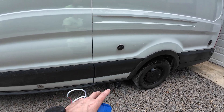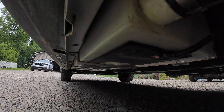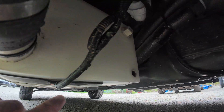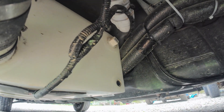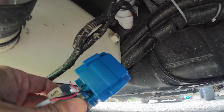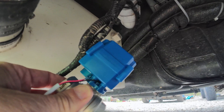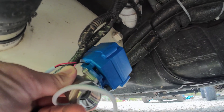We're going to keep everything in place and add this additionally. I'll bring you under the van — you can see this is the outlet for the big line. We have a spare half-inch bung, basically just a cap threaded in there, and that's going to be the basis for how we mount this at the lowest point of the tank. There are a couple of different types of valves you can get: there's a three-wire valve where you apply 12 volts one way to open it.